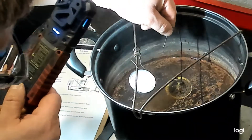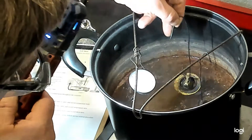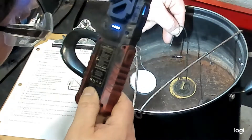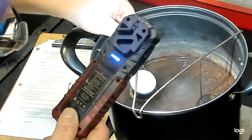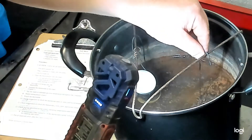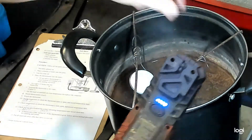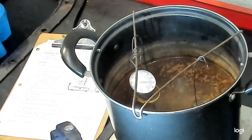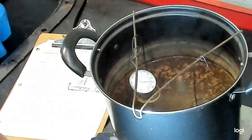I'm going to lift the 180-degree thermostat out of the water. When it's closed it will puddle water — it does not, so it is currently open. It's not holding any water up. Our temperature is actually at 178 and it looks like it has already started to open. So I'm going to write down 178 as my start-to-open for that first thermostat. We'll lift out the other one to check for any signs of opening, but I don't see anything, so we'll put it in and let it warm up further. Make sure it's fully submerged but don't overfill the pot. We'll check every two to four degree increase in temperature so we can spot when it first opens.